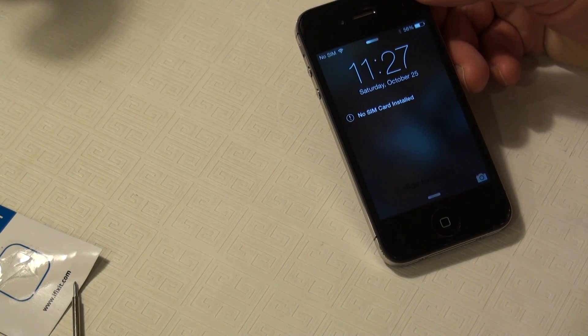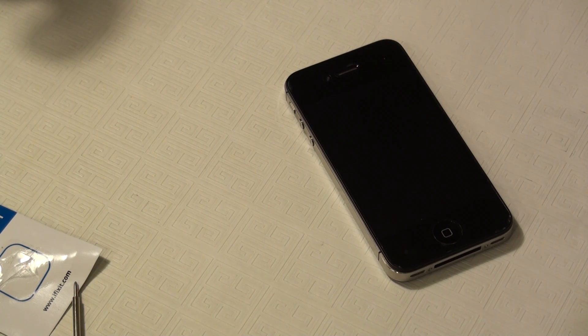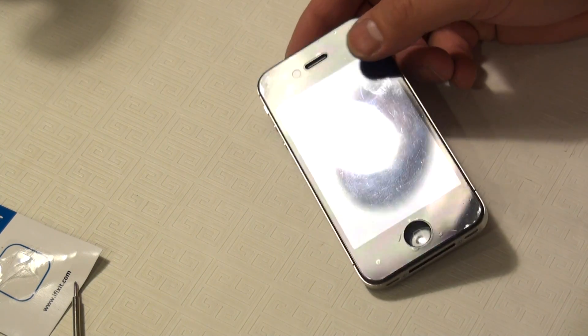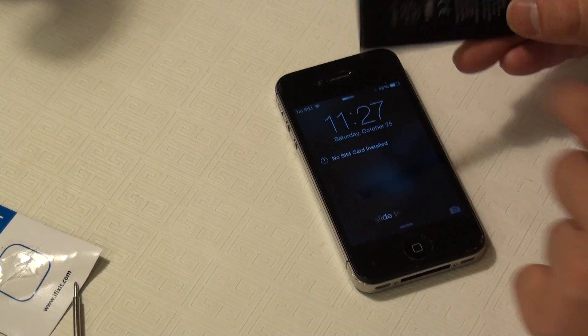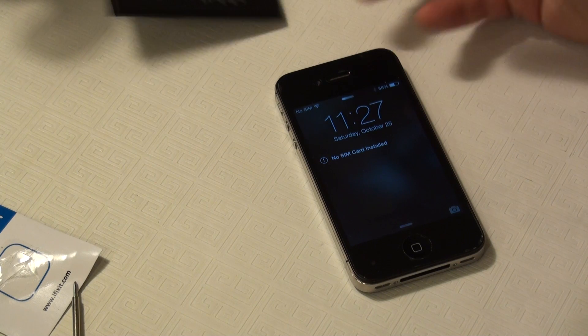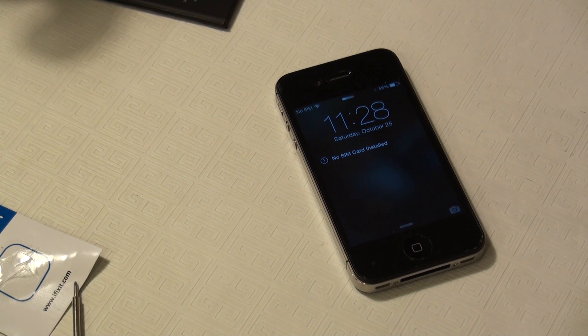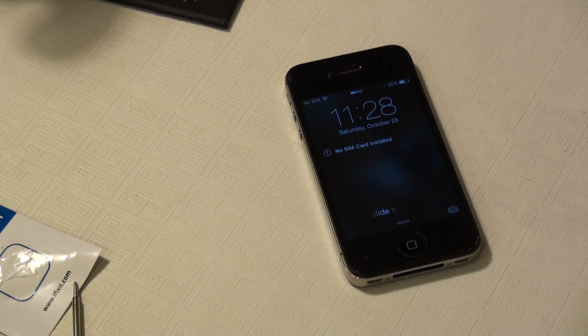For about $35 after shipping, the iFixit battery will give you a good solid two and a half to three years of factory-new performance. On my other iPhones where I've done this battery replacement, it makes a world of difference — the phone doesn't get nearly as hot with a new battery, and excessive heat is usually a sign that the old battery is worn out. That's a real cheap fix, certainly better than paying Apple $140 for their battery swap program. Just remember to give the new battery a full charge to 100% before first use. I hope you found this video useful and informative — rate, comment, and subscribe.